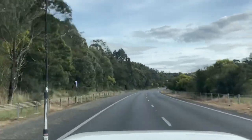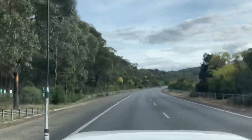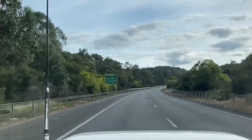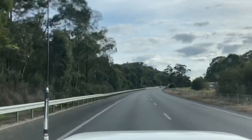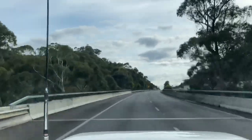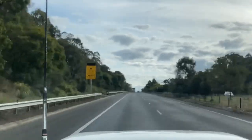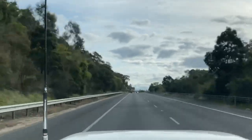Once we get up onto smooth flat road — now I'm holding with my foot controlling the speed at 110 — cruise control doesn't work that well for a four-speed auto Hilux at highway speed. At 2,000 revs and 110, cruising along, we've got a slight uphill. With the foot kept in the same place, you learn how much pressure you can retain before it unlocks. There it is — unlocked already. This is only the slightest hill coming up to the Woodend turn-off. We were down near 70, now 77, 79, 80 — this is how fast it goes up.